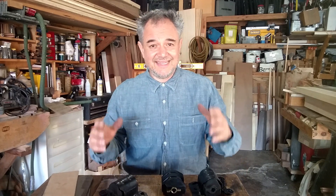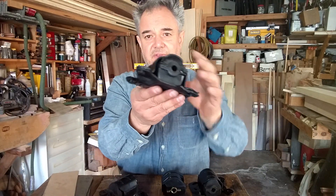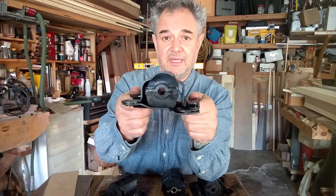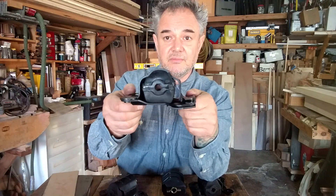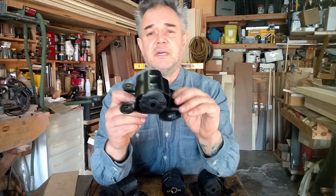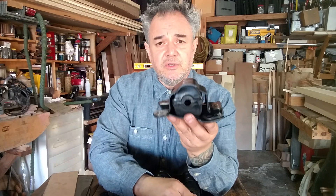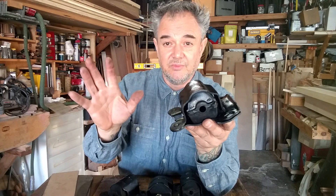Since then I've personally handled at least eight different motor mounts for this vehicle from different manufacturers — they're garbage. I also wrongly thought the good ones were the ones that had rivets. This Napa part is the best mount I've found out there; I would actually use this mount. I'd fill in the space on either side of the cage between the mount and the cage — it's a pretty heavy duty piece of steel. I called Napa all over the country, had friends send them to me, and I have four sitting in front of me. You could drill out the rivets, slide the bushing back, shim between the bushing, and you'd likely be okay with that for a while.